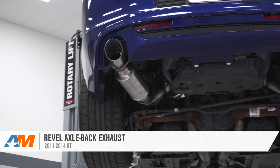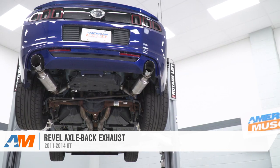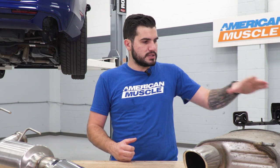The muffler itself is really just a straight-through, very easygoing muffler. It's gonna allow all of the exhaust gases to escape very quickly with very little airflow restriction, making it a lot louder and more aggressive than your factory one. Another big difference is gonna be the size — while that doesn't make a performance difference, with a smaller muffler you have a lot more space to get things in and out, making installation easier.